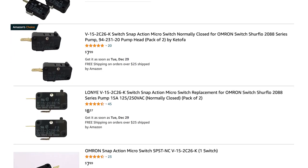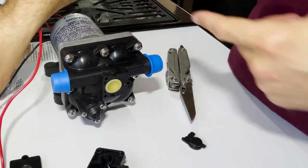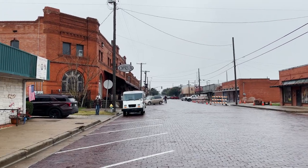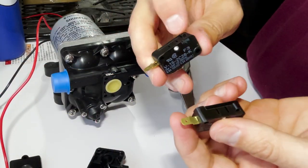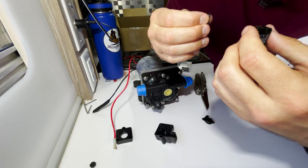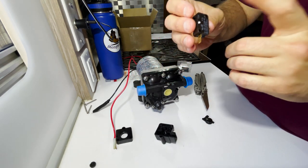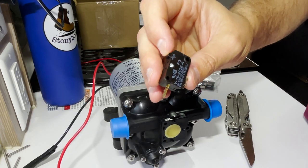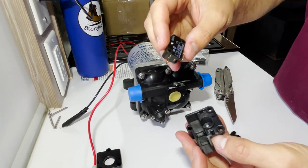I'm familiar with Omron from making blood pressure cuffs. I just looked this up on Amazon and it popped right up. There was a two-pack available, so I figured I'd buy two — that way I have a spare — because I bought two identical pumps anyway, one as a spare. We picked them up at a local delivery shop. My suspicion is that this switch just wore out. I can feel the difference — the spring on the old one is barely functioning. I really think the contact inside burns out after maybe 10,000 to 20,000 cycles.